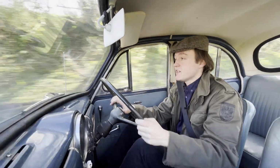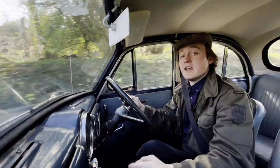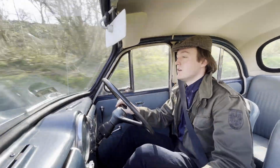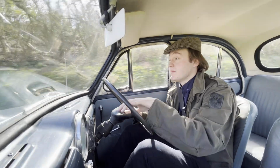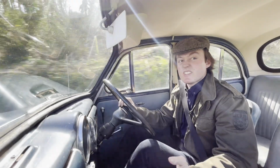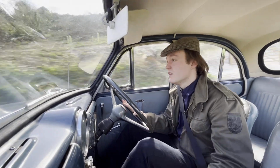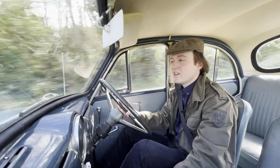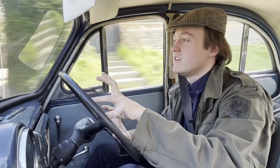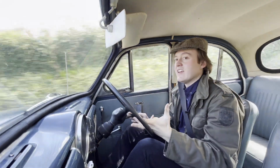I did adjust the distributor because it had been tuned by me by ear to make it run as good as it could for the stretched timing chain. This road is terrible. So obviously we're putting a new chain in, it's tightened everything back up again, so I had to adjust the timing, but I just did it by ear, to be honest. Just turned the thing in one direction or the other. I can't remember if it was retarded or advanced with a timing chain and the geometry tightening. I turned it until it sounded okay.